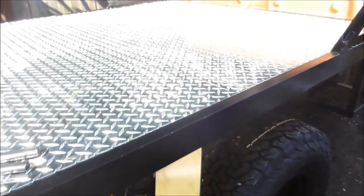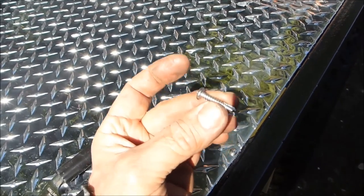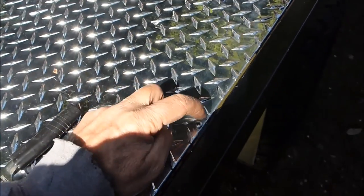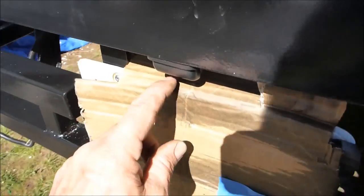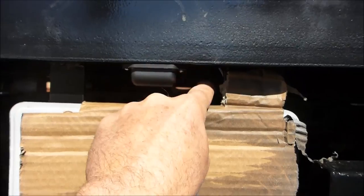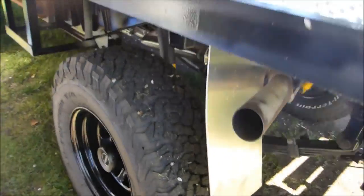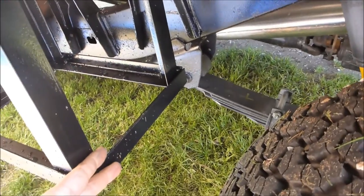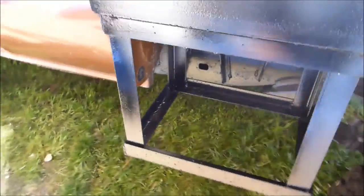A little further in the process — the next day I got the diamond plate fastened down with self-tapping stainless steel fasteners. They're going through the aluminum and into the steel — stainless steel so I don't have any rust and corrosion problems in the connection. I've got them positioned about every 12 inches along the seams, three plates in total. I've got the tail lights hooked back in, all the wiring done, and I'm pulling a wire to power the license plate light. I still have to get access to the spare tire through that port, and the mud flaps are in.